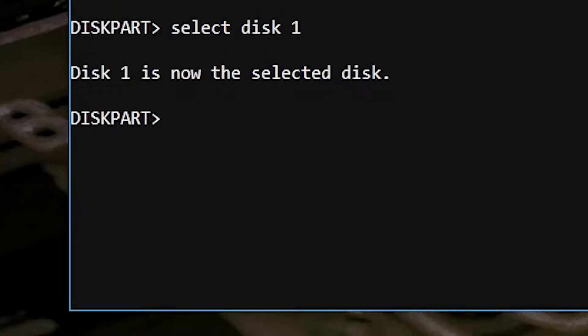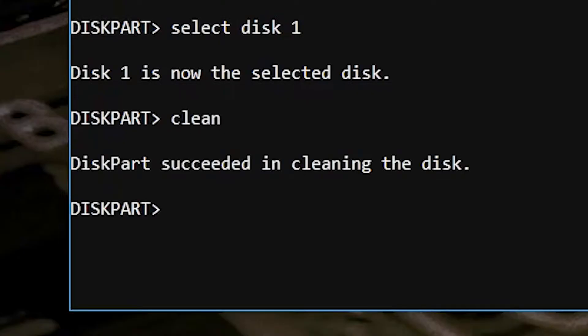If you're not too sure, stop, back up, and take some time. Watch this and go through it step by step. When you feel confident, do it. If you're not too sure, we've got a Discord chat server and we'll gladly do a screen share and guide you through this. So now back to our diskpart — the next thing we'll do with our selected disk is simply type in clean and hit enter. It says diskpart succeeded in cleaning the disk. Essentially what this is doing is wiping the disk, cleaning it entirely, and removing any sort of disk structures — whether it's GPT, MBR, etc.